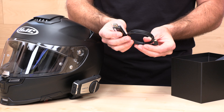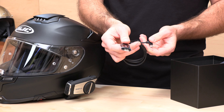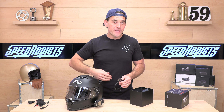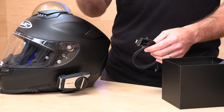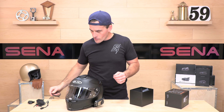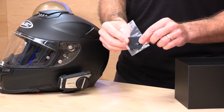Another upgrade — this is only part of the 50 series. This is the charging dongle. You don't want to lose this. It's USB-powered, and one side goes into the unit itself, the other side goes into charging. This is also a Wi-Fi dongle. Once you set this up with the Sena app, it's going to deliver over-the-air firmware updates — a new thing for the 50 series. Previously, you always had to plug the unit into your computer. By plugging in with this dongle, you'll get the latest firmware automatically when you're charging. They also include two windsocks for your boom mic, plus adhesive Velcro patches to help you tuck wires and set up your microphones.